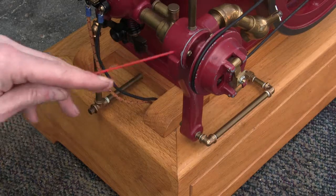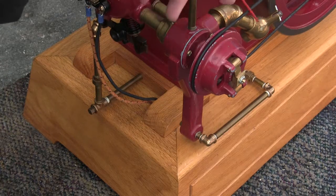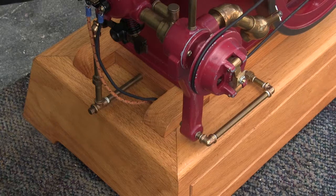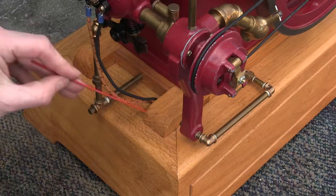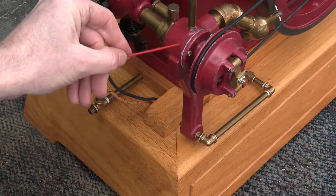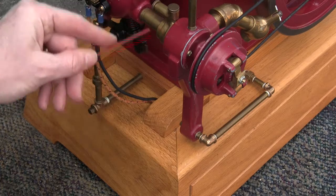Here's the governor, and it also pulls the chain through the fuel. This is a leather belt and it's just clipped here with a wire to allow this to go around. If this doesn't turn around, no fuel gets up to the chamber here and none gets into the combustion chamber, so it won't run.